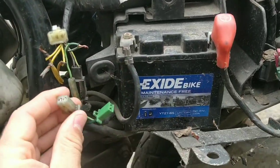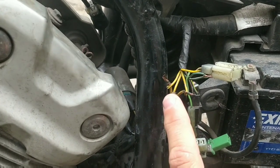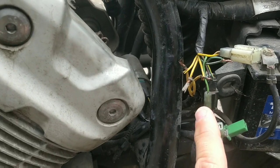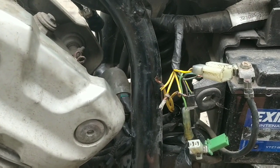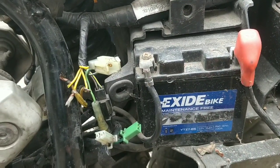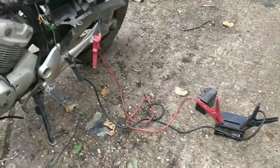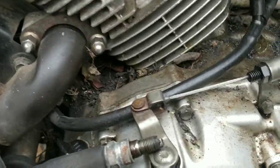The other thing I need to look at is the wires here. I think they're wired right, but you just can't tell. I might have to try other variations - problem is that can also blow a CDI. So the plan is: switch, take this battery off, plug in the new CDI, and just kick it over and see what happens. This is absolutely real time - that's the new CDI with the new thing on it. I'd be so pleased if this showed spark, but I'm really not holding my breath.